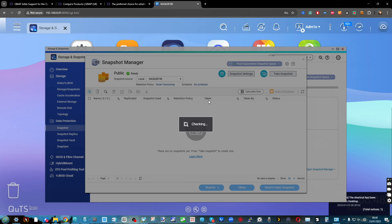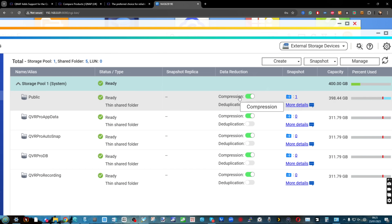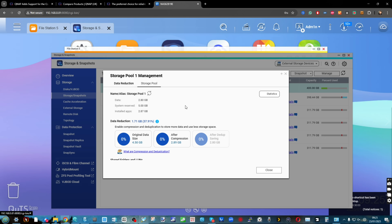Alongside this, there are a myriad of storage and caching benefits. You can support larger snapshot control and creation thanks to the ZFS and QUTS platform. The storage scale-up is significantly improved — EXT4 wasn't managing larger capacities as well. With drives hitting 24–26 TB, a little 4-bay like this could hit over 100 terabytes of potential capacity, and EXT4 wasn't really made for that scale. You've also got inline benefits: inline deduplication, inline compaction, and inline compression, all happening in real time as data is being sent to the system — very few of these are available inline in EXT4.